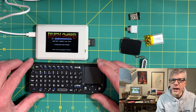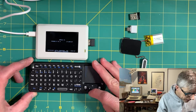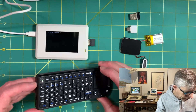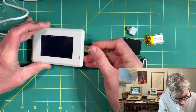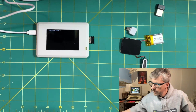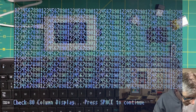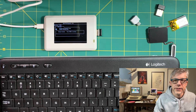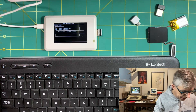Taking a look at the text at the bottom, I think that MFA2 has done a good job at capturing the way that double high res works, especially with its color shifting and fringing. Let's go to the Apple II Diagnostics disk and take a look at what 80 column text looks like. I'm going to switch to a bigger keyboard just because this one is so tiny, so I'm going to pull out the dongle and put in the dongle for a Logitech keyboard. So there is the 80 column display. It's actually crystal clear here on the LCD. And of course, 40 column is also just as readable. It doesn't seem to have any problems switching between graphics and text — whenever you enable graphics, it immediately turns on the color burst, and when you go back to text, it disables or kills the color burst signal.